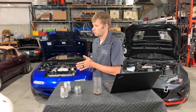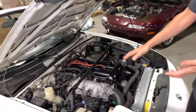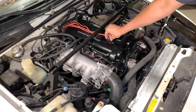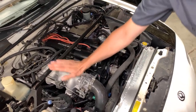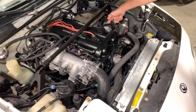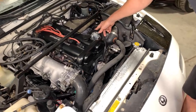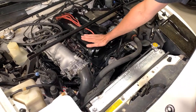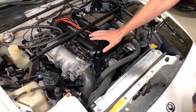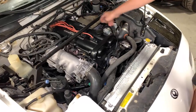Where does it get installed? You have two sides to your PCV system. There's the intake manifold side — which is actually the exhaust side of the system — and then you have the intake side. Theoretically, vacuum in the intake manifold sucks that mist in, and this is your supply of fresh air so it's not pulling against the vacuum. Realistically it comes out of both sides because there's pressure in the crankcase, especially with blow-by. So if you're only going to do one catch can, do it on the intake manifold side. If you're going to do two — which is the right way — you want it on both sides.